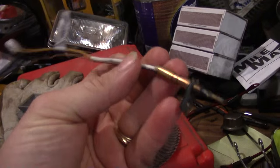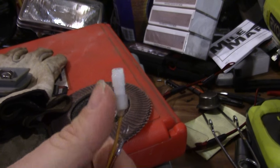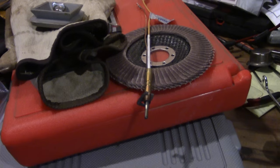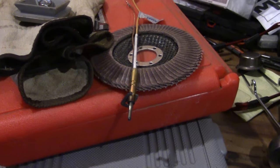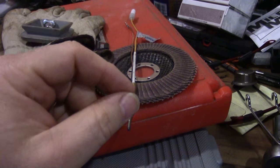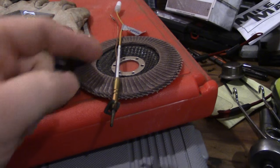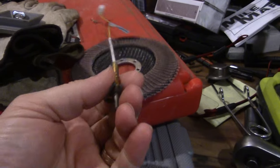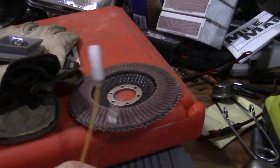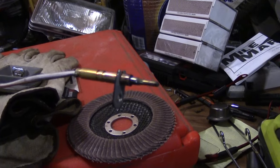The next one they sent is the right thermocouple, but the problem I think I'm having is with the valve it attaches to. It's like a little electric solenoid that holds a plunger in and allows gas to flow through the gas valve. This thing is supposed to heat up, create a little voltage, and pull that solenoid. So it's either this thermocouple or the solenoid itself.